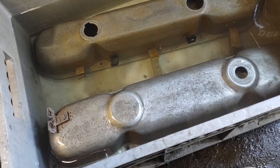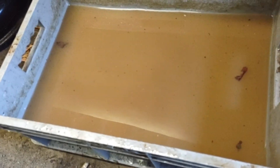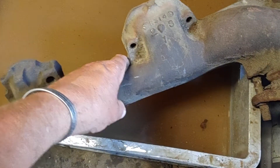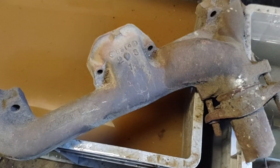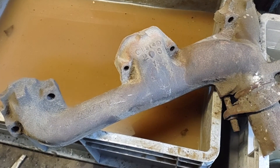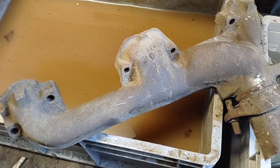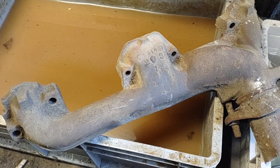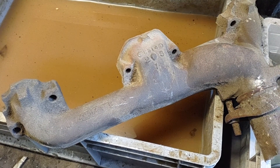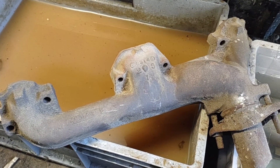I'm going to add some more vinegar and put in this exhaust manifold from a 455 Pontiac. I'll let it sit in there and put another one in too. The only difference with cast iron: when you take them out, you don't need to scotch brite them. Just hose them off, neutralize them, and you can paint them with silver heat paint or black — whatever — and let it go. Subscribe to my page, and if you've got any questions feel free to ask. Thanks everybody.